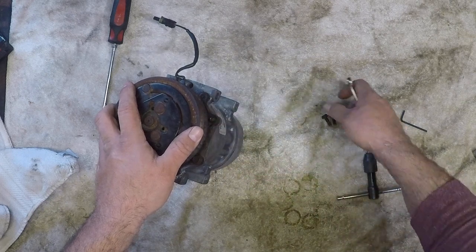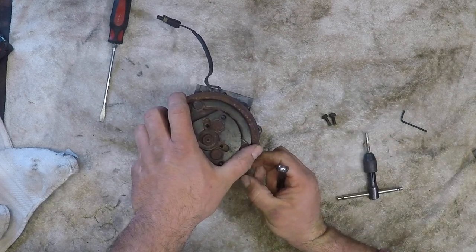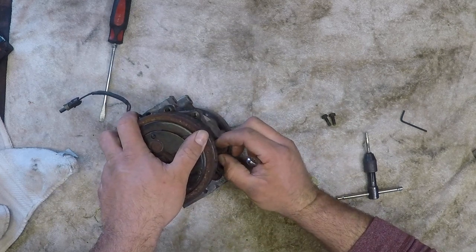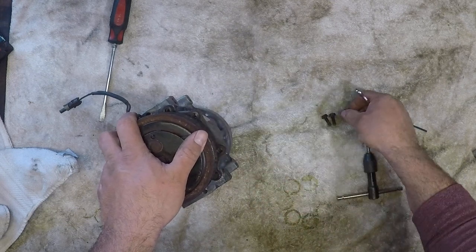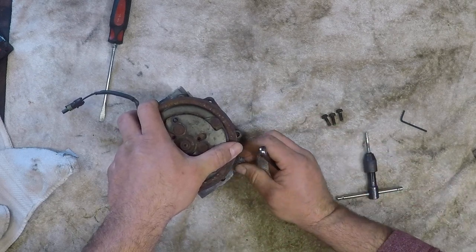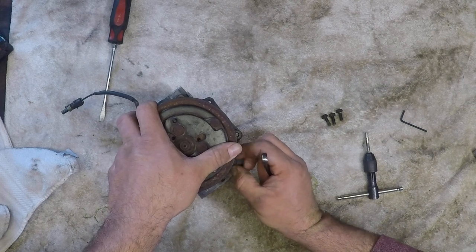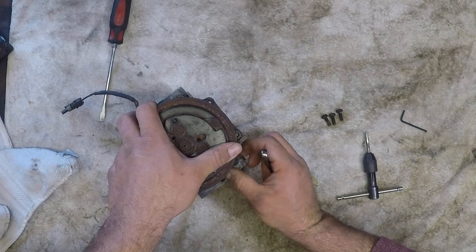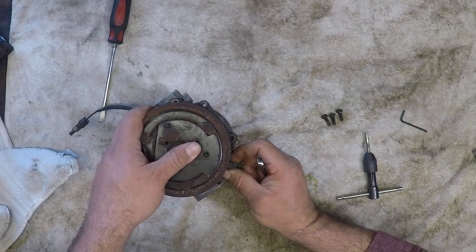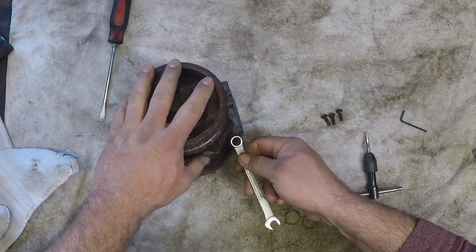Normally when you take this apart it's going to be full of oil and freon left over from the air conditioning system — but that's a good thing. Open it up and make sure it's not all gelled up inside. I've had some older ones where the oil was crystallized inside. You want to get that all out as best you can using good brake parts cleaner. When you take this apart, there's one screw that won't come out due to the diameter of the holes, but that's fine — you don't need to take the clutch apart for any reason.